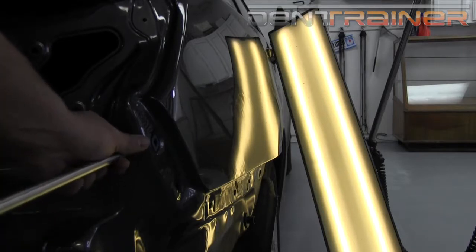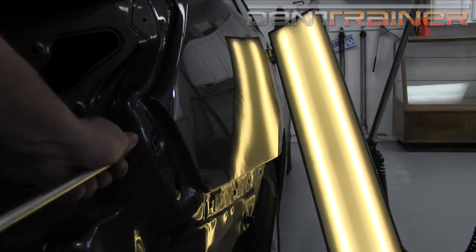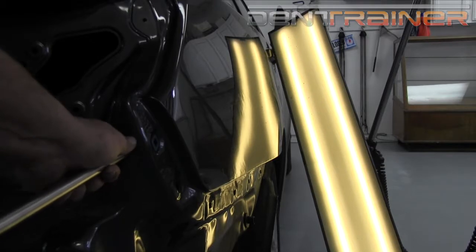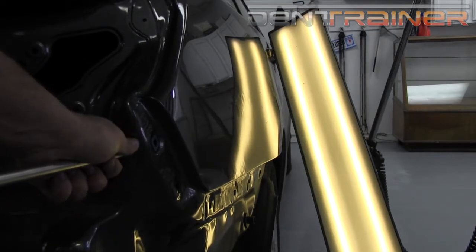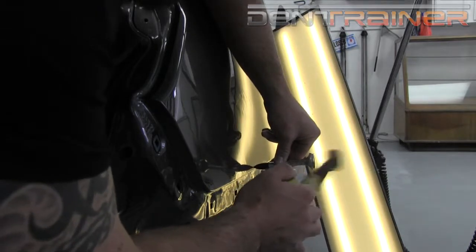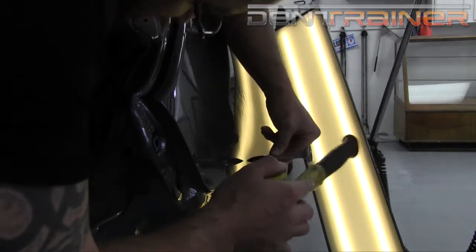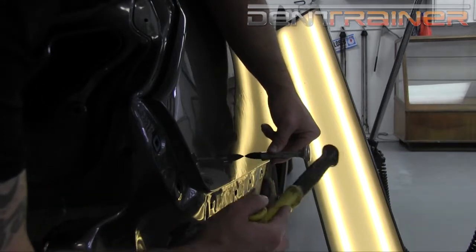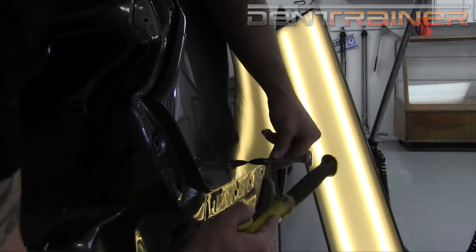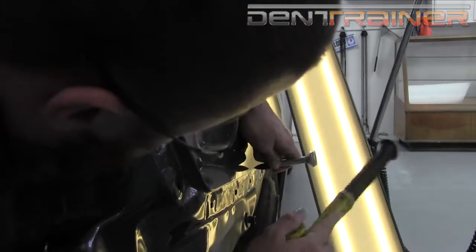So here we go. I'm going to scroll around here — you can see my tool moving around — and I'm going to start off by getting right into some of that crown. You've got a lot of displaced metal in these crowns, and when you're knocking them down, sometimes they break up a little bit, and you've got to get that tool in there and just begin connecting the dots. Scrolling down to the bottom, a little bit of tapping, just blending it out, trying to get the natural curves where they need to be within this panel. Little by little you'll begin seeing this thing take shape — just basically metal sculpting at its finest — tapping and blending and getting things set.